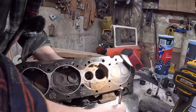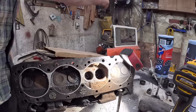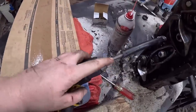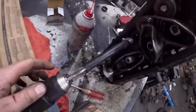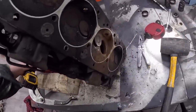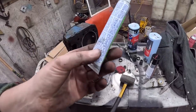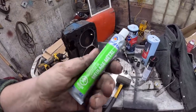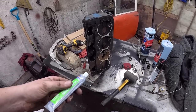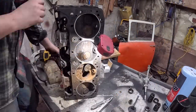But that video I was watching, like I said, he did it for like 20 minutes to the point where the valve was sunk into the head. And it was all fixed up. Dead wrong, but we'll see what happens. So this here's our setup. We've got a drill with a tap in it, screwing into a piece of hose. That'll give us our little rotation. We have the end of the hose on the end of the valve with a hose clamp on it, which will allow in and out to get some goo on it. It's the valve compound. I think it says it's like 120, and then that breaks down to like 220 or 300 or something like that as you use it. So we'll be starting and stopping a lot and see if we can wear this thing in. I don't know. Cars want to run. Let's see if this one does.